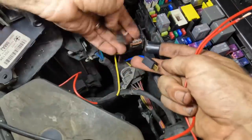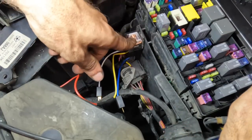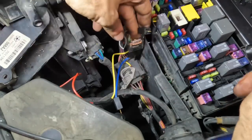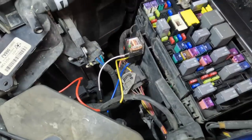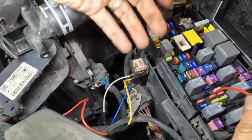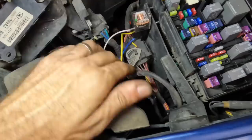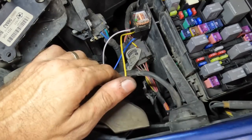The last remaining wires for this relay — the blue and white — are going to be the power and ground for the actuation circuit. The relay is basically a big switch, and that big switch is going to be controlled by a small switch so the smaller switch doesn't have to carry the full current. In this case it's going to be the horn switch. Ground one side, hot the other side — that closes the switch inside the relay, takes power from the relay's power supply, sends it to the load line, and actuates the load — whether that's horns, lights, air compressors, or whatever. This is also so you don't need your switch to carry all the current the load may draw — for example, a light bar might run 20 to 25 amps continuously, but the switch may only handle 10 amps, so we use a relay that carries the load.